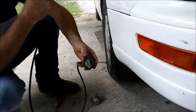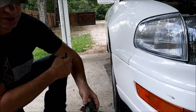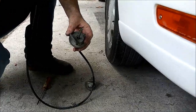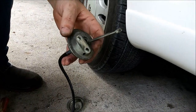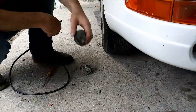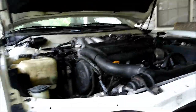That retracts fine with vacuum. What you want to do is suck vacuum in and hold the line. If you have a vacuum gauge it's easier, but this is easier to me than a vacuum gauge. Let's see if it holds and doesn't slowly let out. Okay, that one's holding. It's only supposed to get momentary vacuum, if you don't remember.